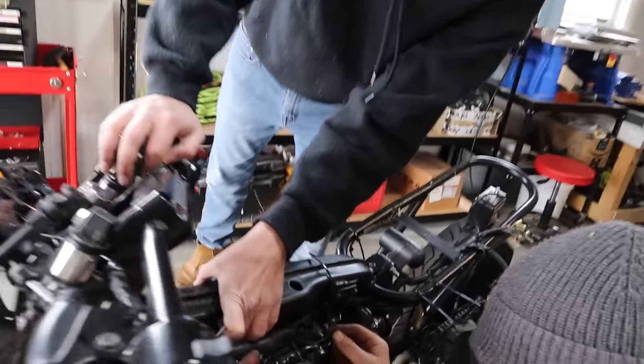Should I feed this back through? Yes, let's run that. And that's going to go to the solenoid. Negative gets grounded — there it is, that's the one I was looking for. Let's see if we can figure out where these head. White, red, green, orange. Turn signal? Neutral switch — right, my bad. I don't see a green red, I see green orange. Is that supposed to be white red? Does it look like mint green? Yeah, more mint.